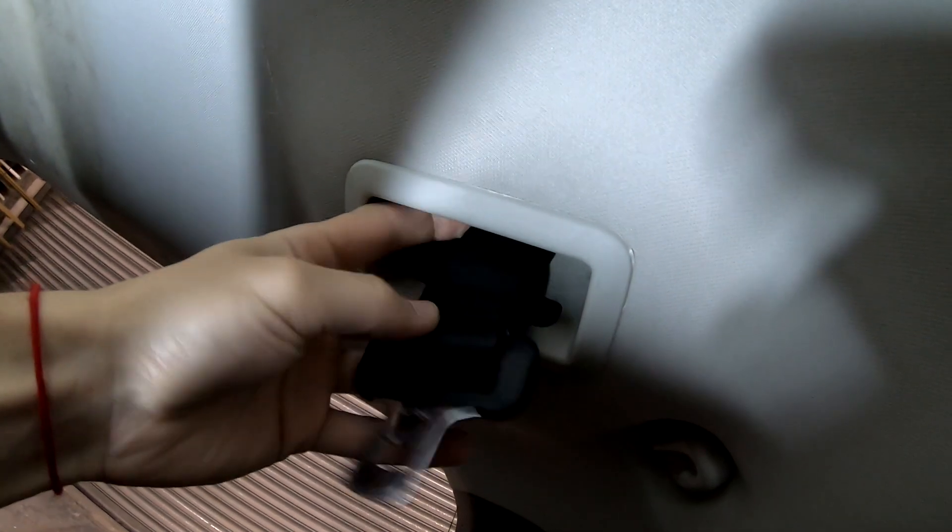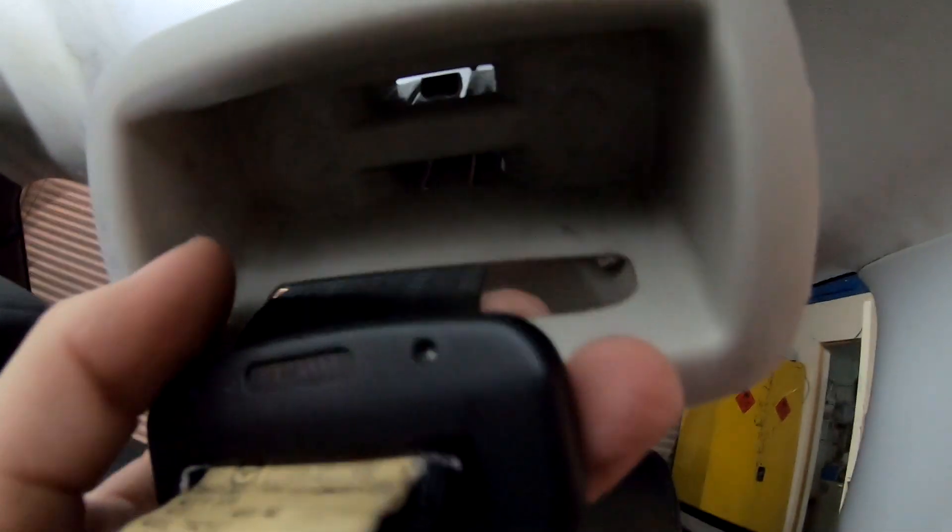Now that's off, so we follow along. It's this piece and this piece — this is just a tab. Pull this off, pull this out, pull that out, and this one you can pry off. Come on, the other tab — come on. There we go, and the belt comes out. See, the gap is big enough that you'll be able to put the belt through.